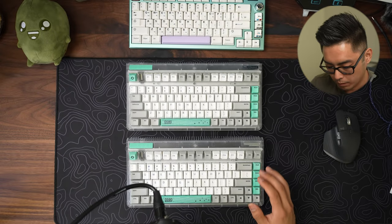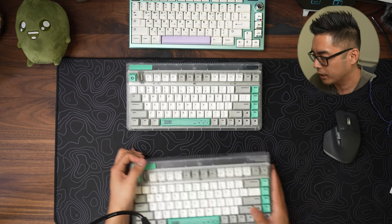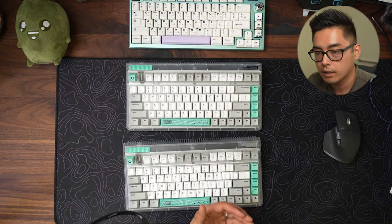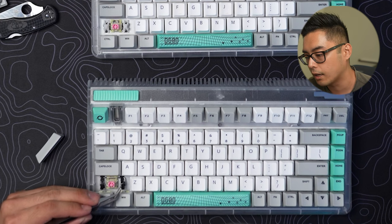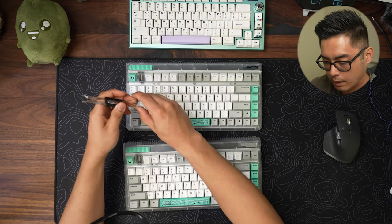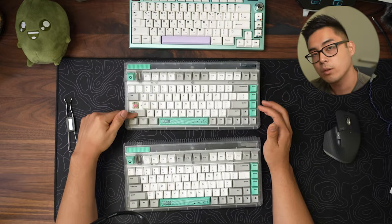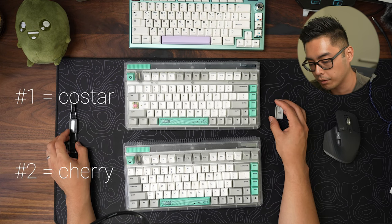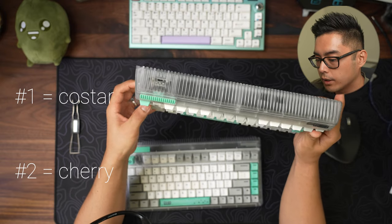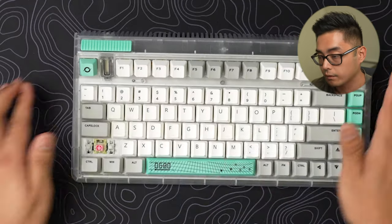All right. The problem is I don't know either. What I can do is pull the keycap next to it, because CoStar stabilizers — it's really hard to reinstall the keycap after you take it off, just because the stems can move a lot more than they can in a Cherry stabilizer. I'm gonna pull the adjacent one. Now we can peek over — this right here is the CoStar.